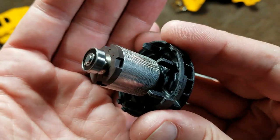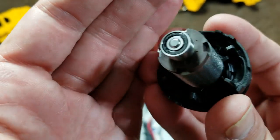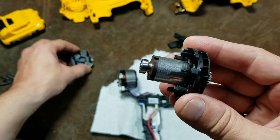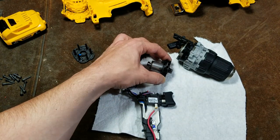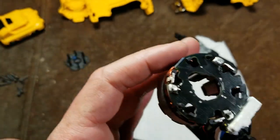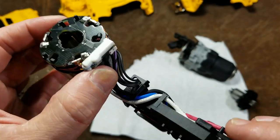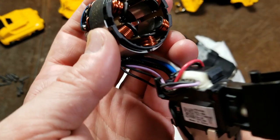There's our tiny little rotor providing all the power. We can see they have a little rubber-sealed ball bearing right there on the rear — assuming the same on the front. So that's always nice to see — a true ball bearing motor. We can see the little tines; when this whole thing is pressed together these create the winding separators and retainers, which is a pretty interesting design. Here's our motor — these are our phase controllers. You have three little magnetic sensors that ping off of this little brown ring, which is a tone ring — kind of like a cam position sensor in a vehicle. That's what all these little wires are for: the hall effect sensor, and then the three main wires drive all the coils.